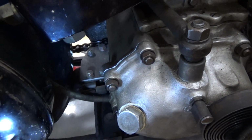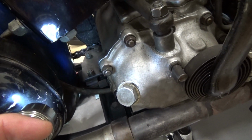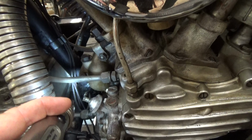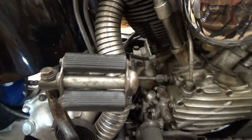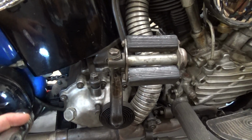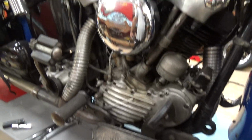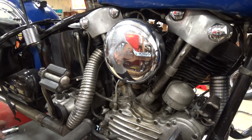Okay, what I have to do is tighten up, or see if they're loose, the transmission mount bolts on both sides. So if they're loose, to actually do that, I have to pull the tranny. That's another pain, because then I get to pull the kicker to pull the tranny. But if they're loose, guess what's going to loosen up? And I don't know if they're tight. So, when I'm fiddling around down there, that is what I'm attempting to do.